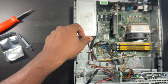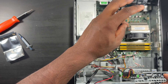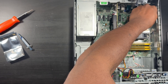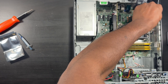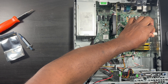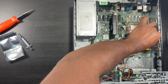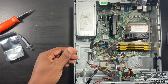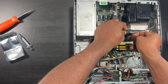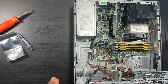Let me reconnect the fan cable - if I close that flap it's going to be hard to get my fingers in there. Pull on it a little bit just to make sure it's in place. Also look at the grooves on this white connector - they match the motherboard, make sure you've got it in. Close this flap back and be careful with these little clips for the wires to hold them in place. Done - very easy project.